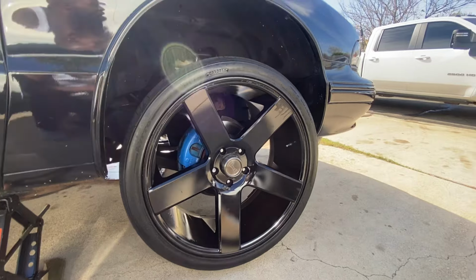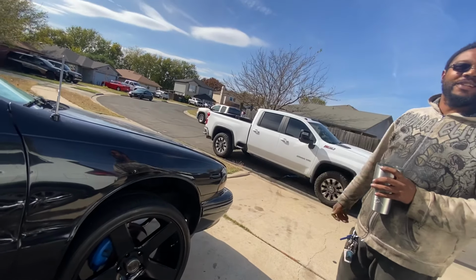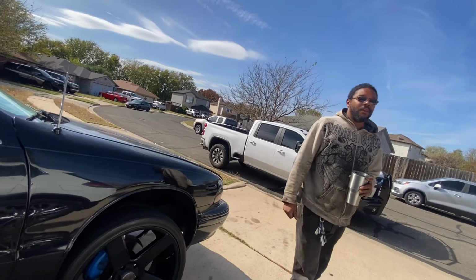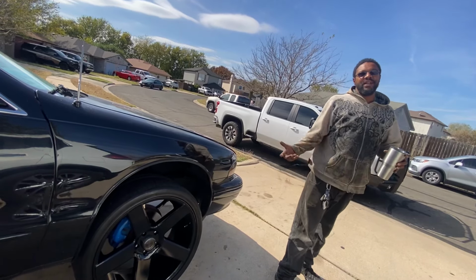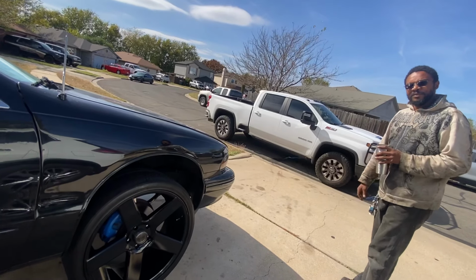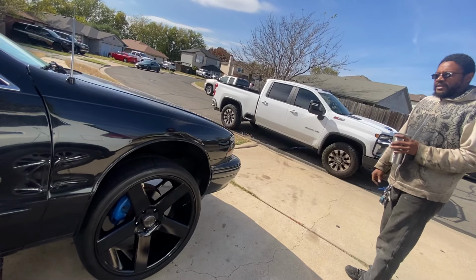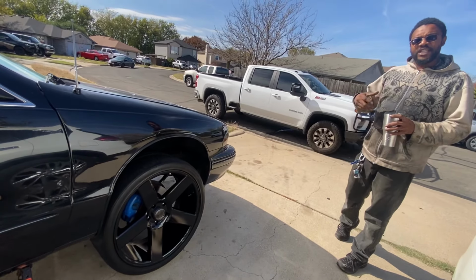But the other truck I got, I was coming back from Marble Falls, hit a pothole, and my upper control arm broke. So it's common? Yeah, that's how they break. It's a 17, it probably never been changed, so I just didn't change them all out. And if it happened like that on this, a 95, yeah, understood. So when you look for them, you want to find the ones that have the steel control arm.